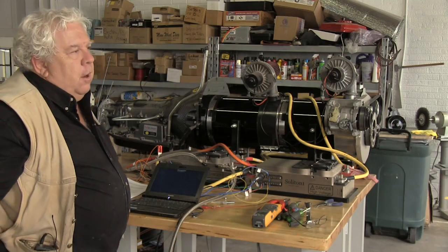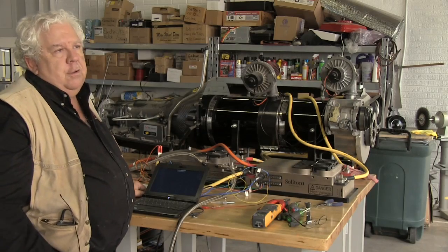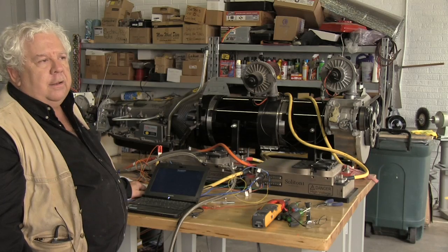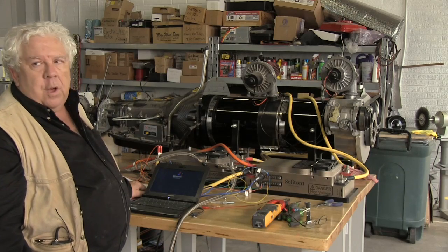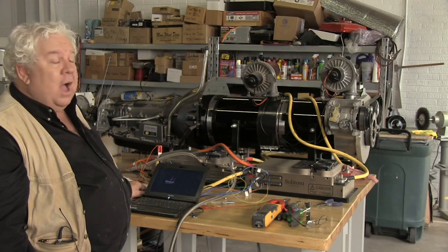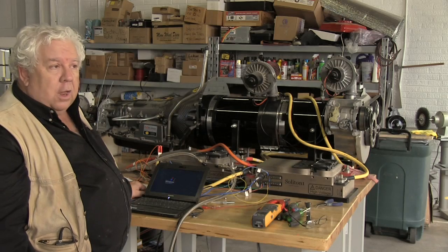Had I simply said, okay, I don't care what you do, I'm going to set the value at 100 volts, so then I can get the full 1,000 amps. The battery pack sags to 147 volts. The controller takes no action, and I'm screaming down the road. So ask me how I know about all this. I made this mistake on our first car, and it drove fine. I thought I was in the cotton.